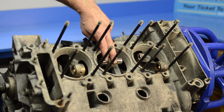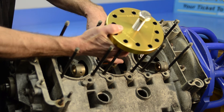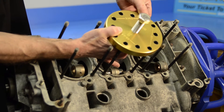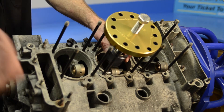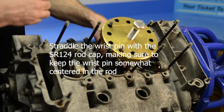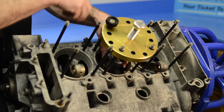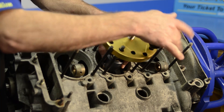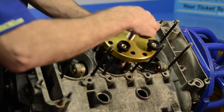Now we can present the SR124 tool, which we have loaded. The tool comes over and you'll notice that the indicators for the three-liter case will line up on the top two studs, and then the bottom two studs will naturally come right through. The rod cap will need to present to the wrist pin, and then at this point everything's set for the thumb screws. Try to keep them all even or close to even so that the platform itself is somewhat evenly loaded as the tool is presented.